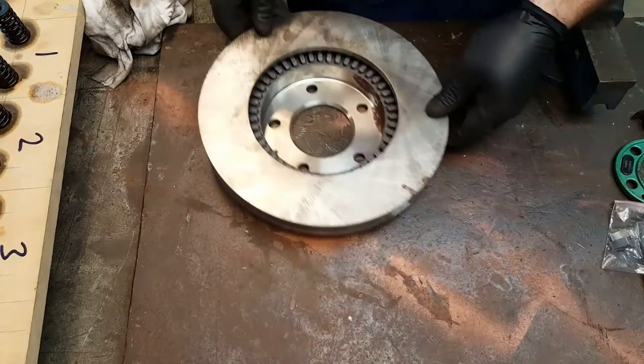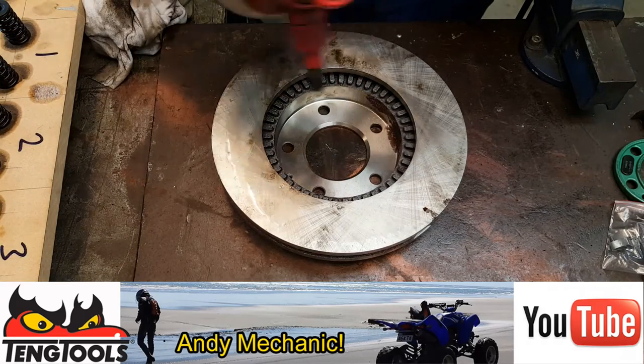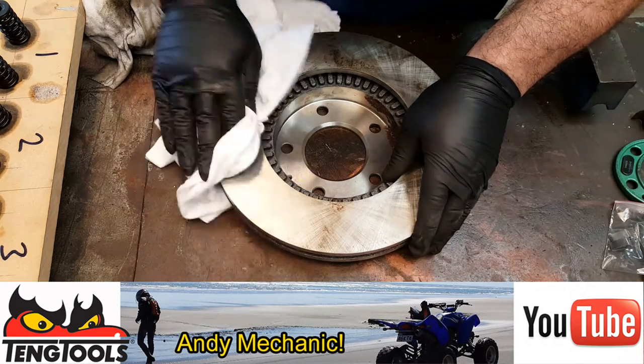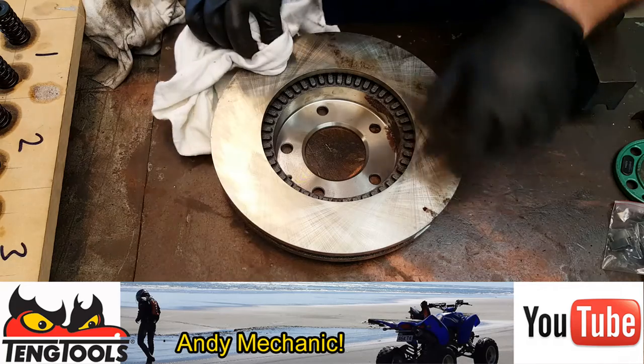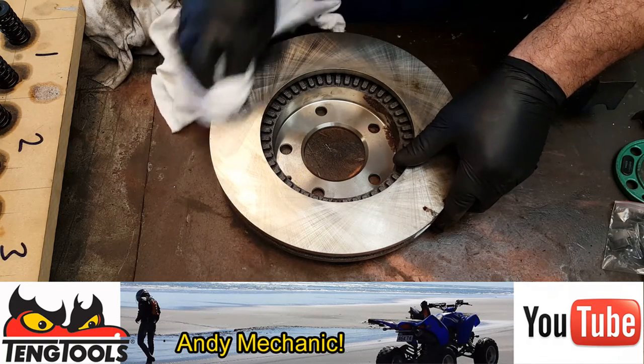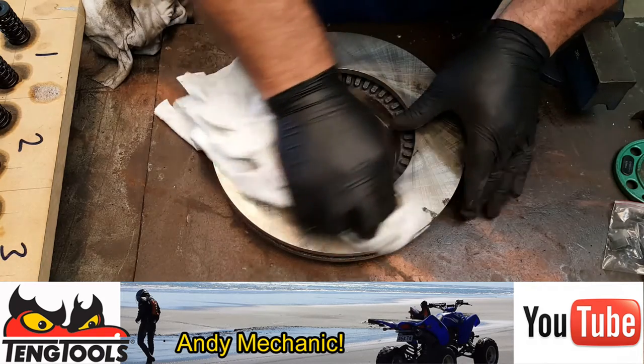So let's get that cleaned off now, and then we can go outside and fit all these new parts to the truck. Right, bit of brake cleaner. Try not to splash the camera, it probably won't like cameras. Nice clean rag. And you can see actually, coming off, there's the dirt, there's the waxy stuff coming off. And the good thing about brake cleaner is it evaporates away, so it leaves no residue whatsoever.